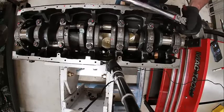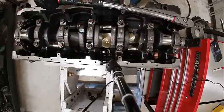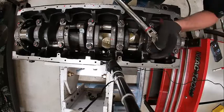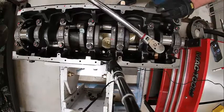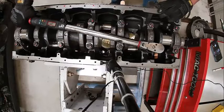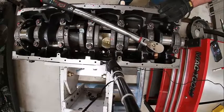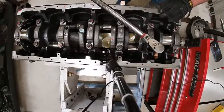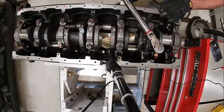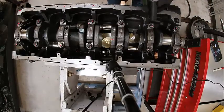We ended up at 121 degrees and 343 Newton-meters. If we convert 343 to foot-pounds, that's going to be close to 250. I can double-check my marks as I do this. I had to reset it — I went 144, so I can take 24 degrees off that, which should be 96, which is right there, so we stop there. That's why it's a good idea to put your mark and double-check yourself.